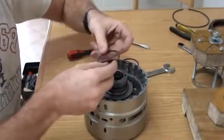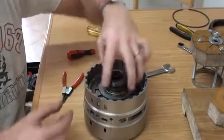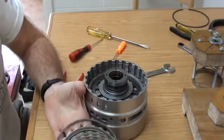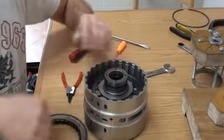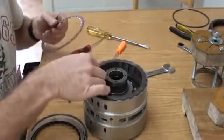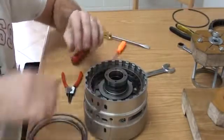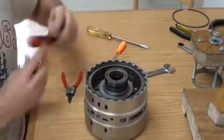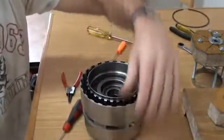Before I put the clutch pack in, I'm just going to replace those two plastic O-rings — very simple task. And then I can put the two clutch packs in. As per normal, you can see: undulated spring followed by steel, friction plate, and so on all the way to the end where we have the end plate, and then finally the snap ring that goes in. And the same on the other side.